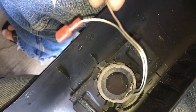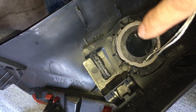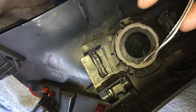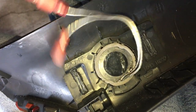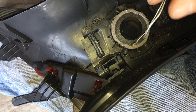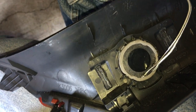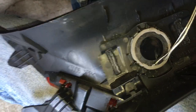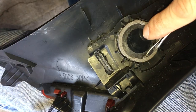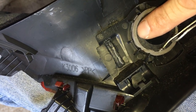I have the bass blocker connected on the positive side on my tweeter. I took off the factory tweeter, which actually has a little capacitor on it and I think cuts off even higher — probably around 10,000 Hz based on its size. This is the JBL component tweeter, part of the component speaker set I got — you can check the unboxing video where I showed all the speakers.